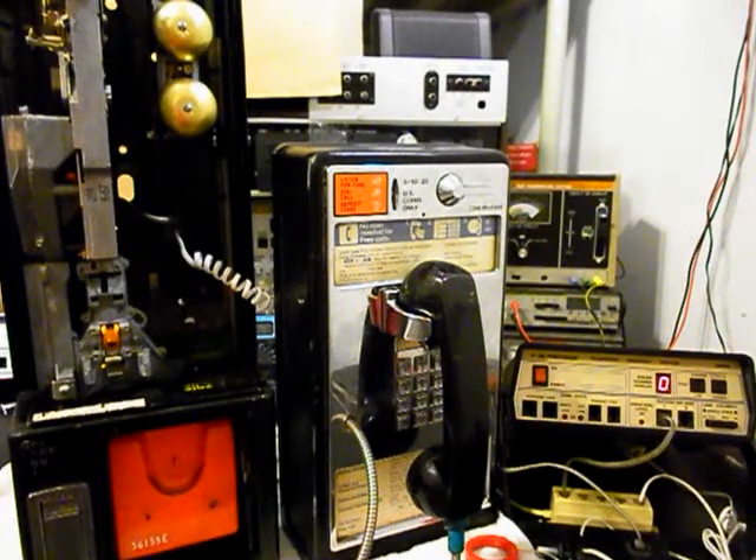We also want to run through a little bit about what went on. We installed a modular line port so you can simply bring in any length, any color line cord you choose, plug right into the modular port for a simple, easy plug-and-play connection. We also installed our circuitry to make this payphone dial out, and we rewired this unit the way we wanted it wired. We installed a bell and bell circuit, made sure the change was falling through the coin validator into the cash box area, went through the hook switch reconfiguration, and troubleshot the security cable, transmit, and receive.